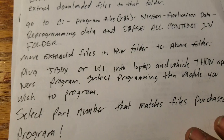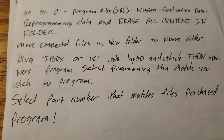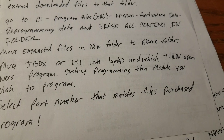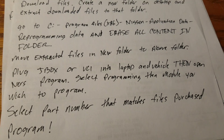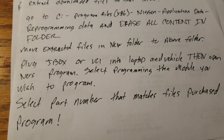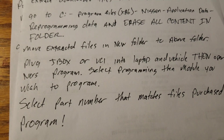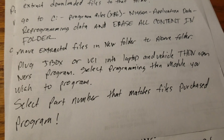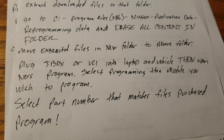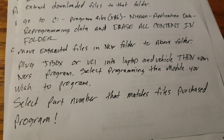You can always call Nissan for help, but if you want to view service bulletins they charge $20 — so Google them instead. If the programming isn't right, or the module or downloaded files aren't right, it'll say programming and never go past 98% — then kick you out with an error. If you're getting an error at 98% programmed, you either have the wrong part number selected or don't have the files extracted correctly into the folder.